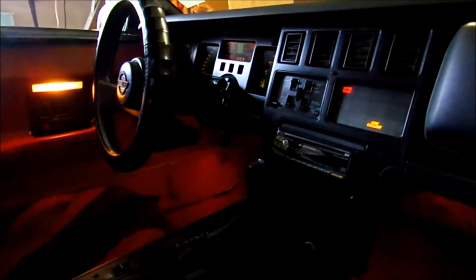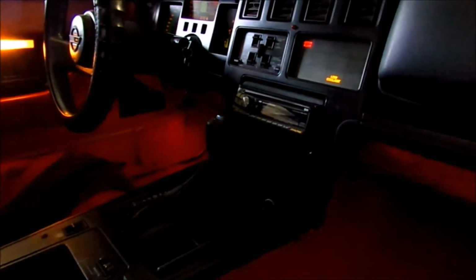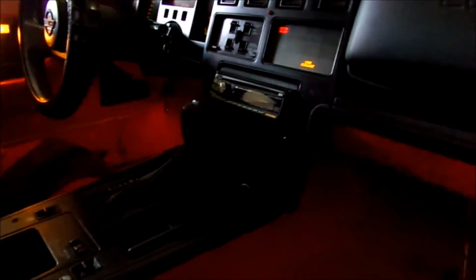Alright, we've gotten it back together, and pushing the plugs in didn't help on that. The fan controls work fine, but I'm getting hot defrost, and I'm getting it hot in the floor, and it's coming out good. So I don't see any leaks anywhere. So getting the heater core in and just getting the heat where it will warm this sucker up and defrost it, where I can use it as a daily driver or drive it back and forth to work, as of now is a success.